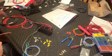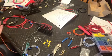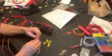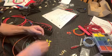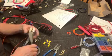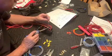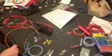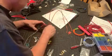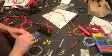Okay, so now you see me messing with this 16 gauge orange wire. That's going to be for our fuse 1, which is the ECM, and on this harness, the ignition power that controls everything. So this is your hot side power, and we've got 2 wires in there, so we just want to make sure they're both soldered together as well as to that connector, since they could get some stress. And then we'll label those, and each one's labeled separately.